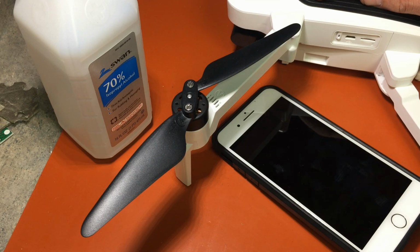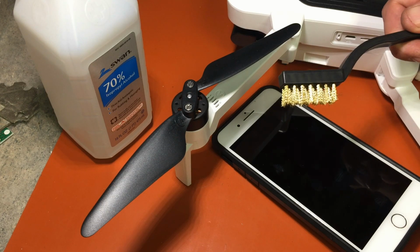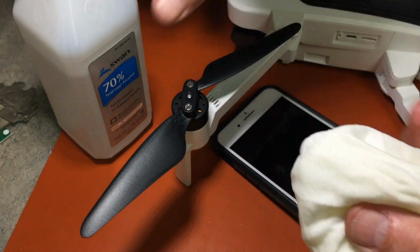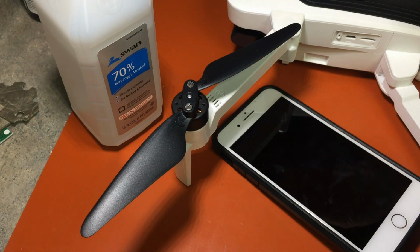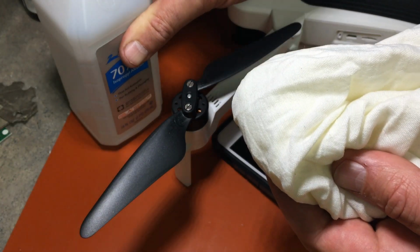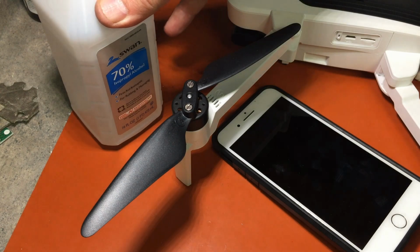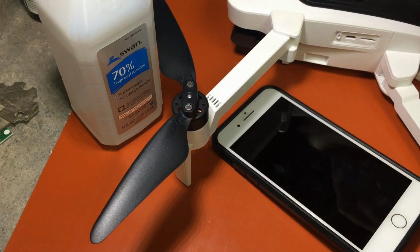I just want to remind you, when you're done soldering something with your joints that close together, make sure you take something, like I took my brush and just kind of lightly went over them, and then I took a lint-free cloth with some alcohol. You can use a flash-free electrical cleaner. There's different things, but I just took the alcohol and put it on my rag here, and I wiped my solder joints nice and clean, so all that excess flux and stuff is cleaned up.